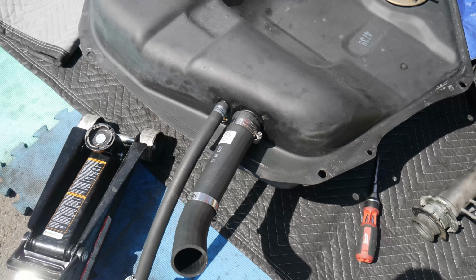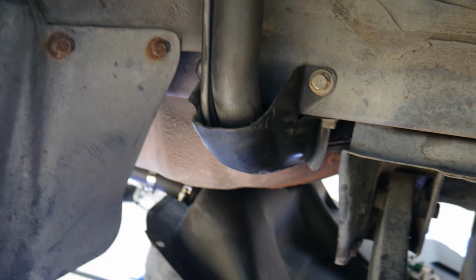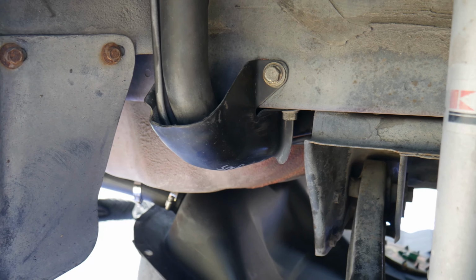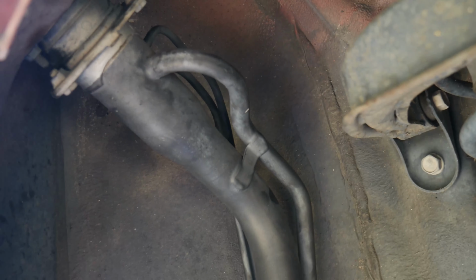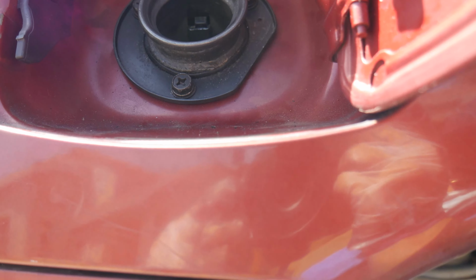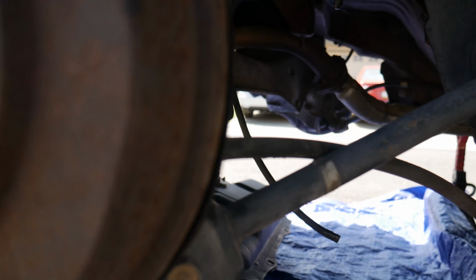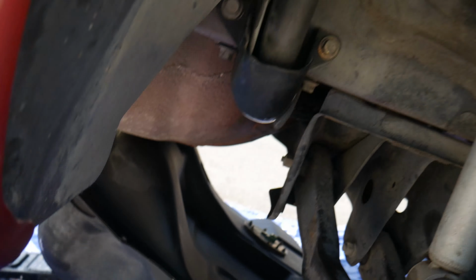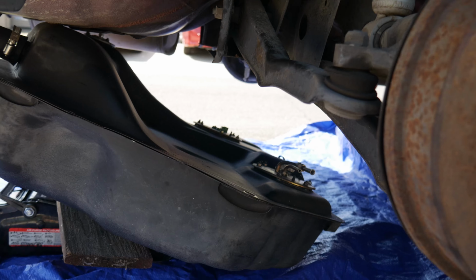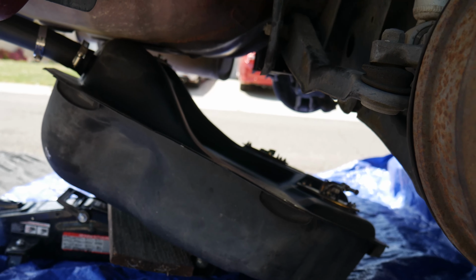All right guys, let's see if I can record this. I just got the protective shield for the fuel filler neck, and that's just 4 bolts, 14 millimeter, and as you can see it's all cleaned up nicely, as well as these 3 that go into the fuel hose. That's 3 10 millimeters. So now, like I said, we're gonna have to raise the tank with the jack so it supports it up in the middle of the car. After that, we're just going to connect the hoses and then bolt the tank right in. So let's get on to that.